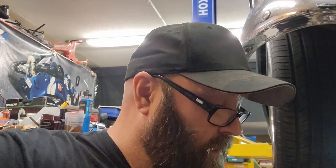Now that I know there's plenty of room and the tie rods themselves aren't bottoming out but the sleeve is — if all I have to do is cut a half inch or three-sixteenths off the ends of this sleeve, that's what we do. We're doing this on the budget, guys. These used to be nine bucks a piece, now they're like 22 — that's 44 dollars for both sides. Not a lot of money but it all adds up. I'm saving 40 bucks here, 100 bucks there, 300 bucks there — and at the end of it you can fix your car if you have 1,500 bucks to spend.